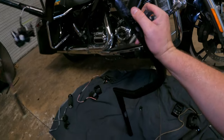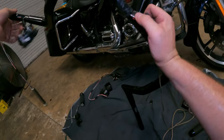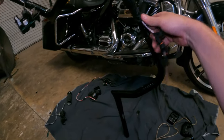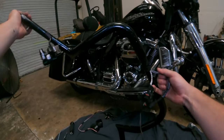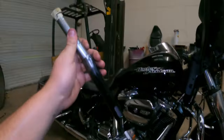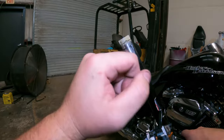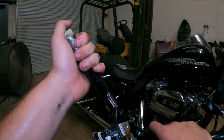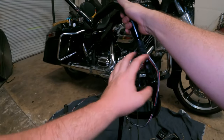It's hard to do when you're trying to balance it yourself. You can do this on the bike but I feel like I don't ever have enough room. There you go — I've got the switches and the throttle-by-wire, I'm just going to run this all the way out. You may or may not be able to run your O-ring on your throttle-by-wire — find that out really quick. Make sure you line up the teeth. If they're new bars sometimes you have to grind or sand that out. These are used bars the customer brought in but they'll still work. The other side is way easier — you only have one wire, super simple. Same process, I'm not going to film that.